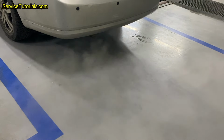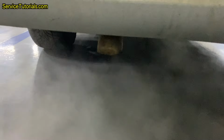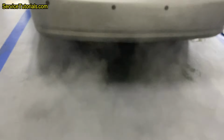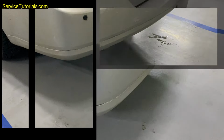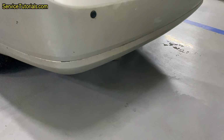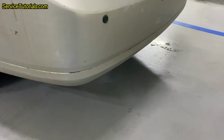When the white smoke no longer comes out, I turn the engine on and leave it running at 2,500 RPM for a few minutes to start cleaning again the DPF filter. You can see the white smoke still coming out. This cleaning process with the GerTechTeile DPF cleaner can be done in less than 60 minutes, in a car repair shop or even in your garage.